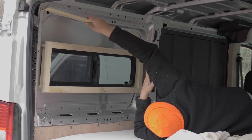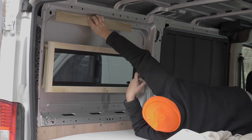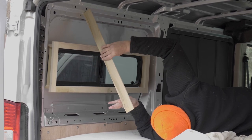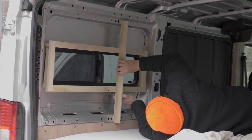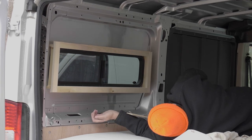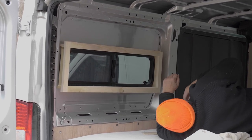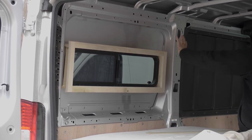This screw hole in the top left corner is basically a bit over 8mm higher up than the rest of the holes. So by putting an 8mm spacer along here, everything's going to line up. You can see by having this window frame that's taller at the bottom than the top — exaggerated, it's like this — how everything's going to line up so that when I put the panel on it's all going to be screwed down and lined up perfectly. We'll screw into this which will provide a nice framework for the window. We'll also put four magnets on here that hold it against the metal so it doesn't vibrate. Everything is looking good — we can proceed to start putting the sound deadener on and get ready to build this panel.